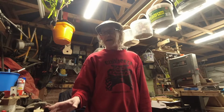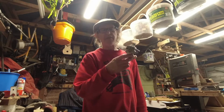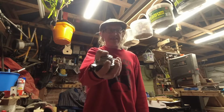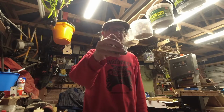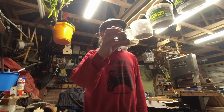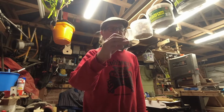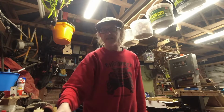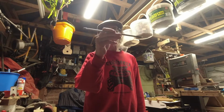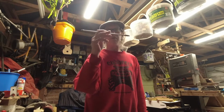went to put the slave cylinder back on, this little guy here, and he wouldn't go anywhere near the gearbox. There is quite a bit of resistance against that spring, but you can push it in. And what it was doing, it was bottoming that out, and as I tightened the screws up and pushed it into the gearbox, it was pushing this rod through up against the ball bearing, against the plunger, and it was opening the pressure plate, so it was never going to drive.